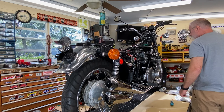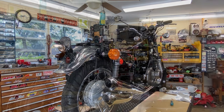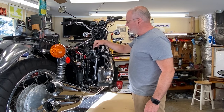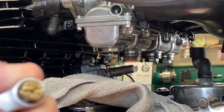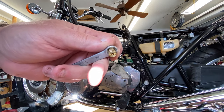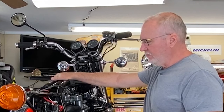I'm going to bump the mains up a little bit more. I failed to mention I don't have 122.5s in stock, so I just bumped it back up to the 125s — that's the ones you saw in the last video. Really quick on the jetting: it's really an art to jet these things, and by no means am I an artist.